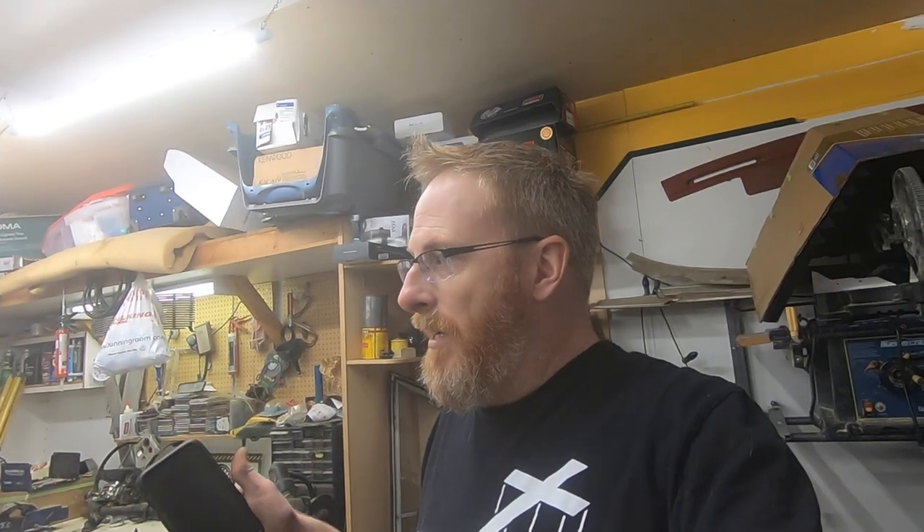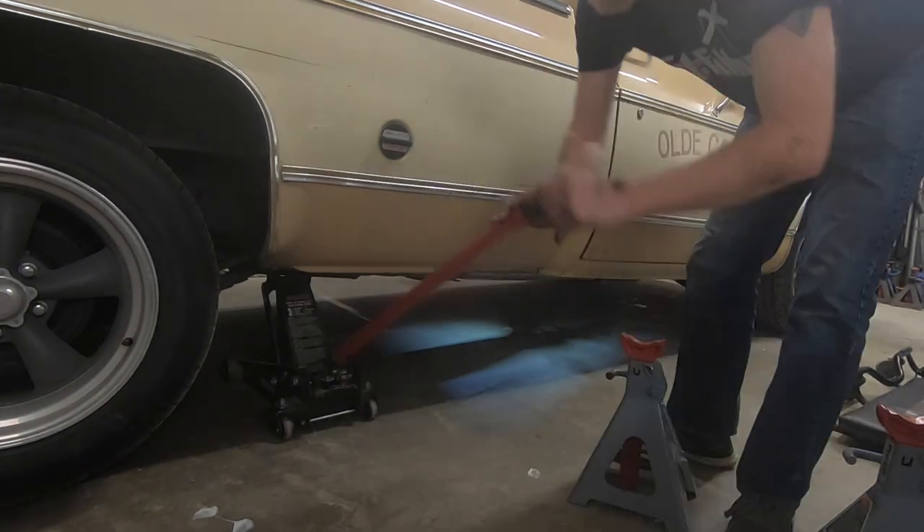Let's hit the road for the second drive with no stalling and just see what kind of power she's got. We've got the truck backed out, fuel gauge is working — at least I think it is, it's showing full. I did an IAC relearn once again because I found a vacuum leak while tidying things up under the hood. I've blocked it off for now — that's the vacuum for the overdrive control switch. I'm going to stop off at Napa and grab a T, get that plugged in, and then we'll go for our drive. Maybe we'll even check the fuel economy — put about 30 or 40 miles on it, top up at the gas station, and do our calculation.